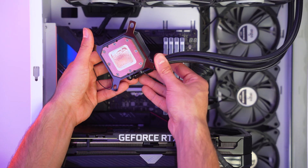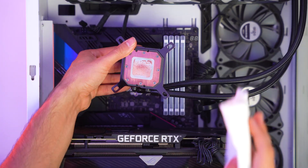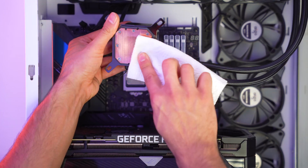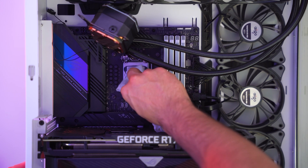And gently take it out. This is what it looks like after two years of working with the CPU cooler — it looks pretty bad. Now get your towel paper, make sure it's wet with alcohol, and simply wipe off every thermal paste you see on the surface. After you're done, put it on the side and do the same for your CPU.